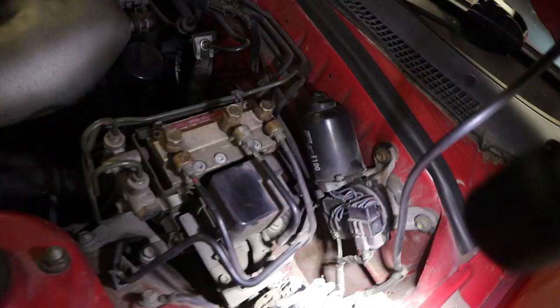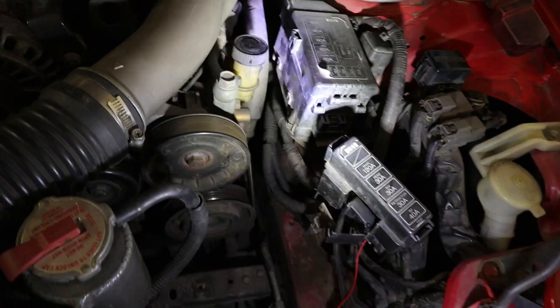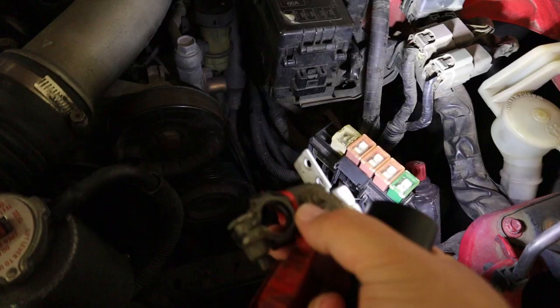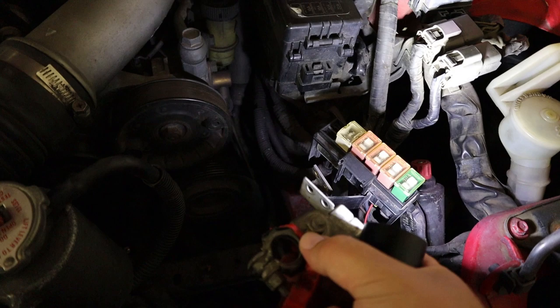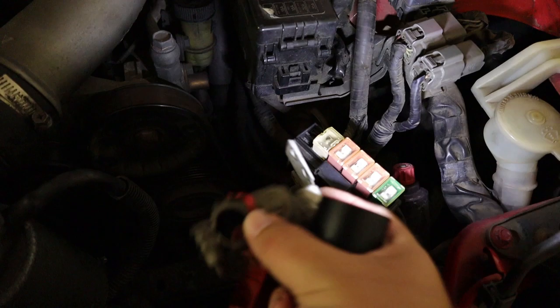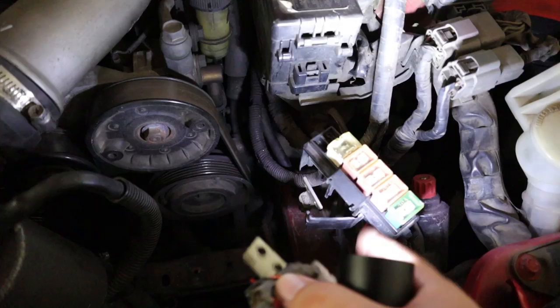Once we're there, we can go through that other hole in the side of the fender into the engine bay. I'm going to make my connection back to where the original battery location was right here. I pulled this cover off - this is normally hanging off the side of the fuse box and connects into the positive post of the battery. You just take two 10mm bolts off, move this little clip that's just a flap that snaps in on one side, and then you can basically just wiggle this out. I'll need to take this back to my workshop to make some modifications.